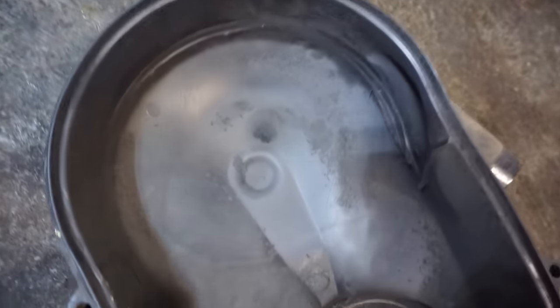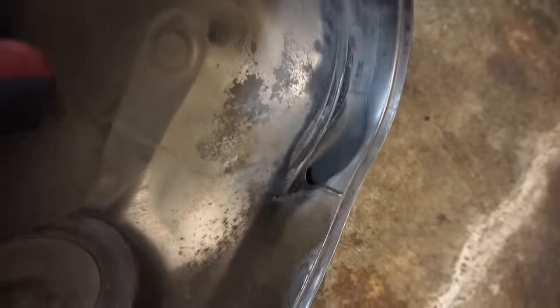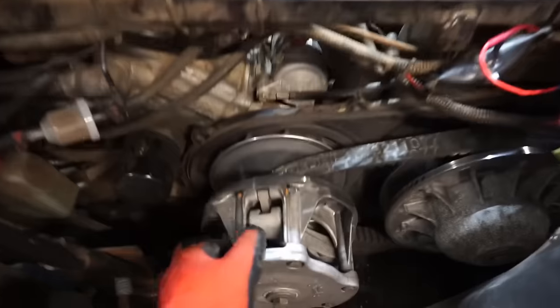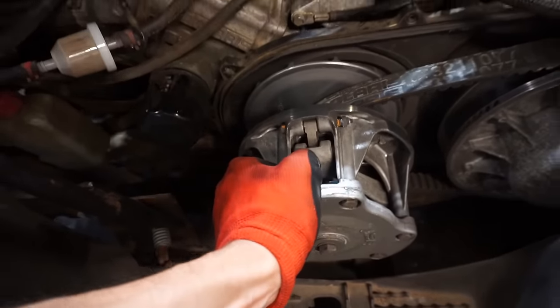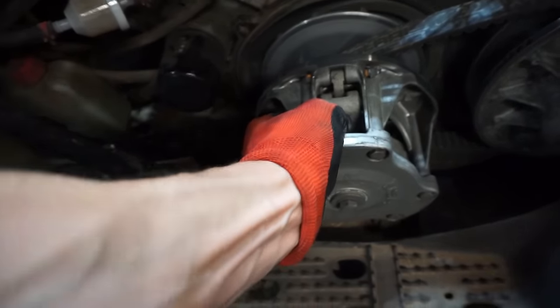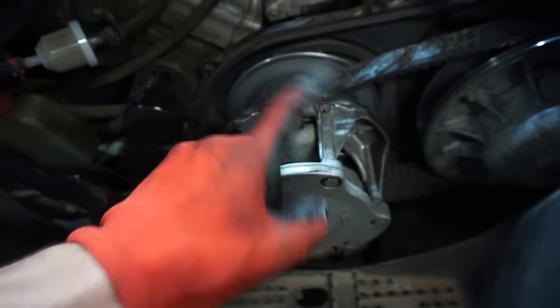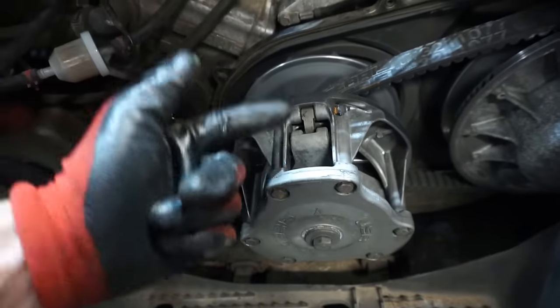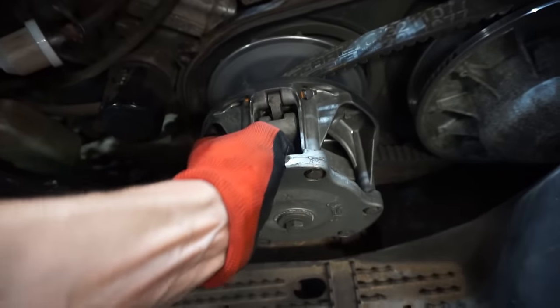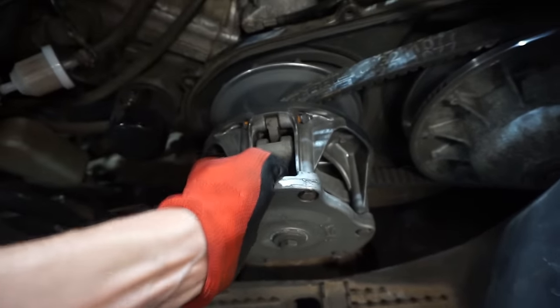Quick check on the inside of the clutch cover. You can see where it was rubbing all the way around right there. So it's either this clutch has a bunch of play in it and the crank is bad. No. There's no up and down play in the clutch, because sometimes these cranks can just get really bad and then have tons of play. So then when it spins, it gets higher up and cuts into that cover. But I'm not feeling any play in the clutch at all, which we got lucky with.